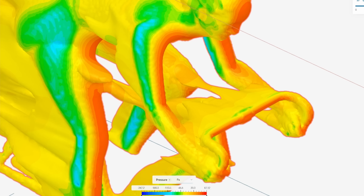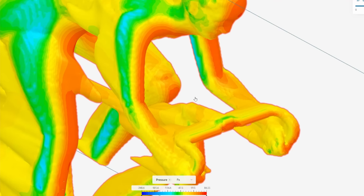What you can see in this plot is a contour plot of pressure, but the actual volume you're seeing is everything in the model going less than 17 km/h — the free-stream velocity is 40 km/h. So the airflow coming onto the rider from the right-hand side of the screen is 40 km/h. Everything visible in the 3D model has been slowed to less than 17 km/h. You can see behind the handlebar all this volume — all this wake behind the handlebar — is going slower than 17 km/h, so it's been slowed down before it hits the rider's legs. There's a bit through the middle which hasn't slowed down to that extent, but I just picked 17 because it shows the contour where it's just reaching the rider.